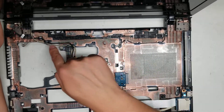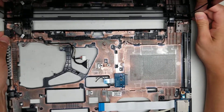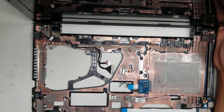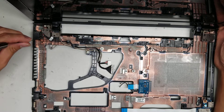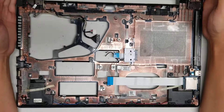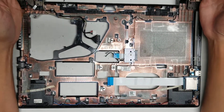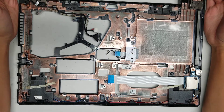The hinges — you just take them out and the whole screen will pop up, but if you do that, make sure you unroute the wireless antennas and also these cables. There's also the DC jack here, so if you need to replace that, it is held in with some clips. To remove it, use a thin pry tool and pull the clip to the side to pry the charge port out. That's pretty much all there is to this model — hopefully this video helped you. If it did, please like and subscribe, and thank you for watching!